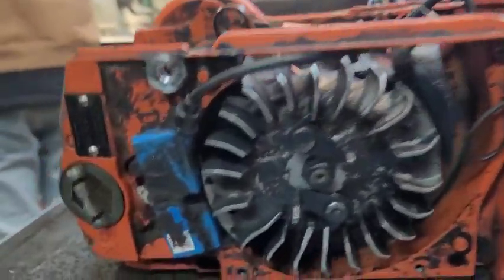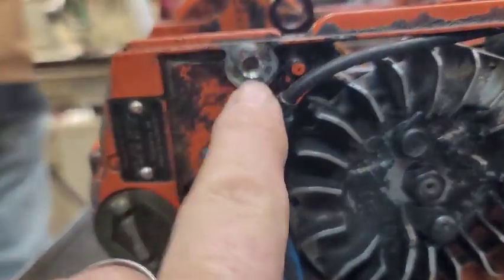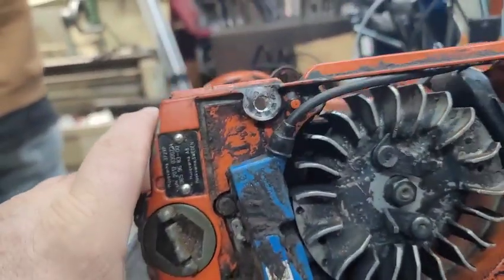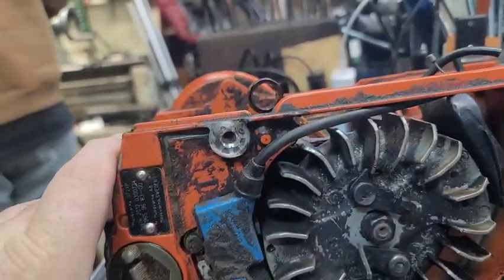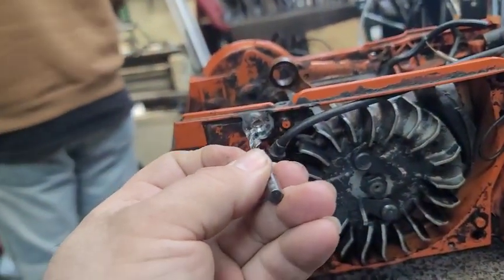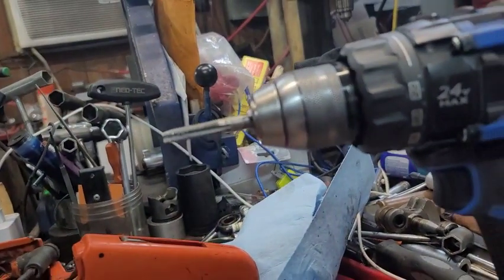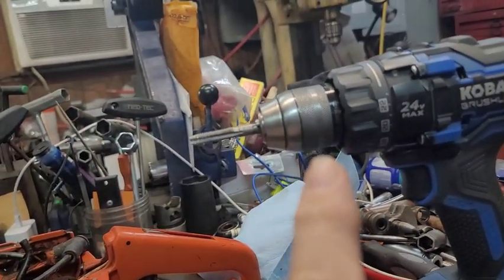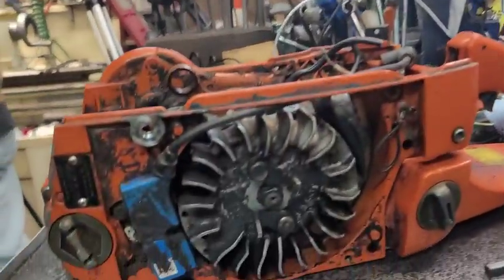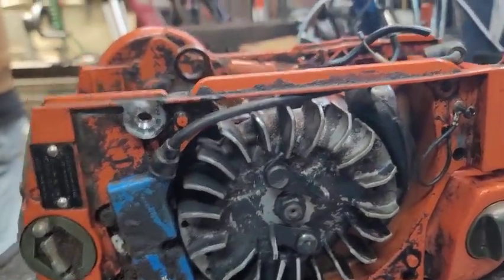This is one of Andrew's cases, and this hole right here is messed up really bad — so bad that the helicoil wouldn't fit in it, and I didn't want to go up to a six. What I've done is took a 17/64 drill bit and rammed it through the hole, then took an 8x1.25 tap in the electronic tapping device — use at your own risk — and ran it through there.